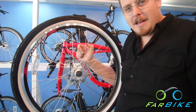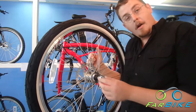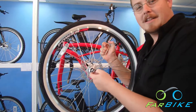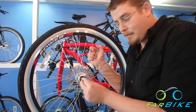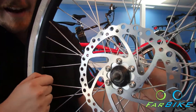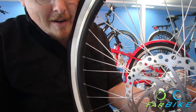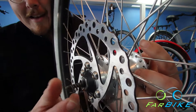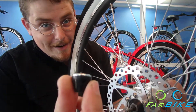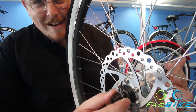Take your quick release axle and your wheel, and slide it through the center hole in the wheel, just like this. Once we slide that in, you'll see the quick release lever is on the side opposite the brake rotor — we want that so it doesn't run into the brake rotor. It's a little springy because of that one conical spring. Now go to the other side, push in the spring, take the conical spring with the smaller side facing into the wheel, then take the cap and screw it on. Just do a couple of turns because it needs to be loose to put it on the bike — we'll tighten it once it's on.